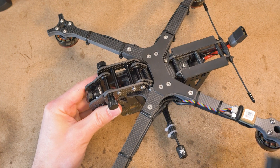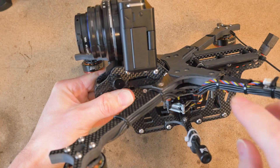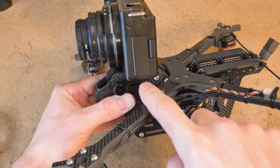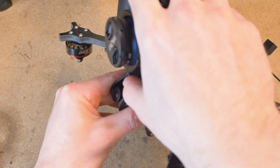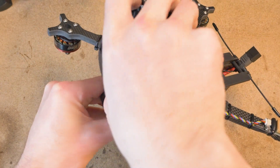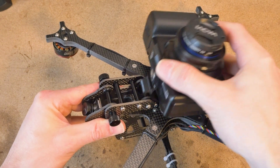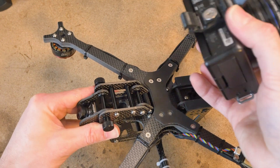One of the important things we'll be talking about today is the camera quick release mechanism — optimizing that clip so it has a stronger hold and increases durability over time through use. One small sub-trick: after you release these you have to twist the camera to release the back one. If you try to yank it off you're going to break the clip.